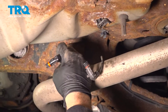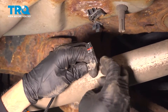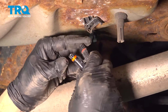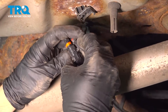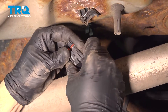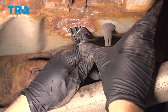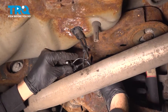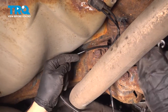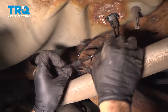I'm going to feed our sensor up here. Let's go ahead and make sure that our surface here is clean so that we can mate these two together. You're simply going to line them up and snap them together. Feel them lock together. At this point, go ahead and line them up and reinstall these. Press it up and feed your sensor up over the original passenger side wire here.